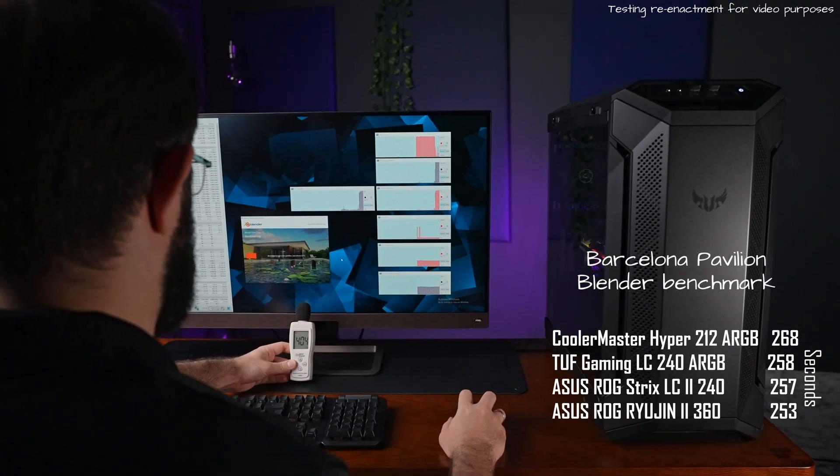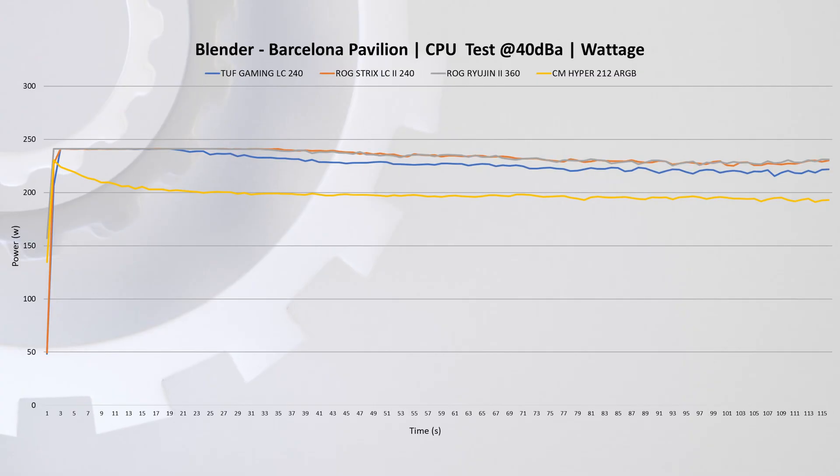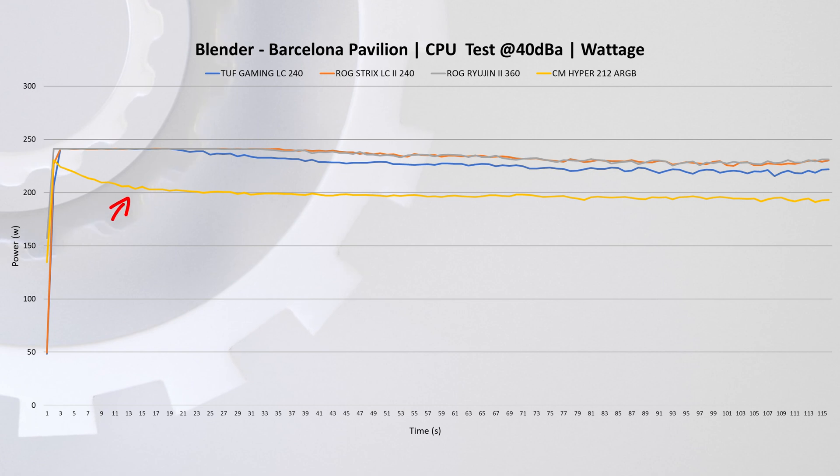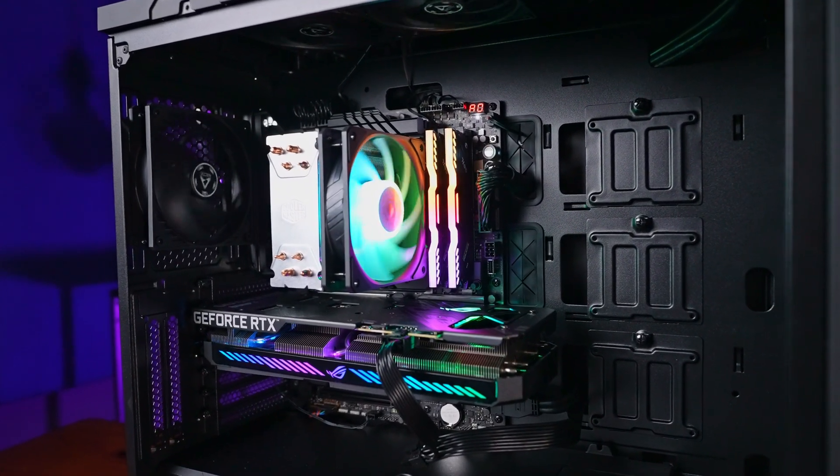Render times were only a few seconds apart from each other. Looking closer, the CPU was able to push harder while using the Strix and Ryujin coolers — this is visible in the wattage graph where all three start off strong, but after a while the TUF Gaming cooler starts to thermally throttle and the CPU reduces its speed to compensate. The others follow but more slowly and never drop as much. The reason we look at power consumption rather than temperature is that all three fairly quickly hit 100 degrees, which is where the CPU naturally reduces speed to stay within thermal limits. The budget Cooler Master unit is not enough for this CPU — almost immediately thermally throttling — and would be more suitable for lower-end CPUs like i3 or i5 series.